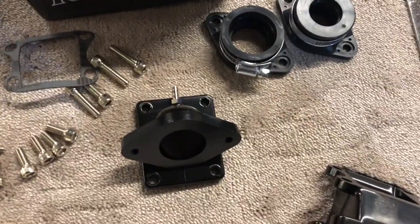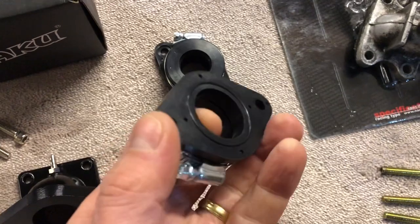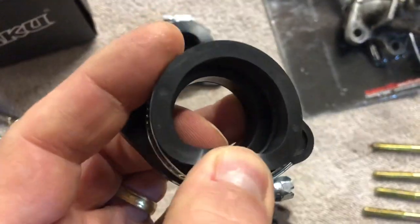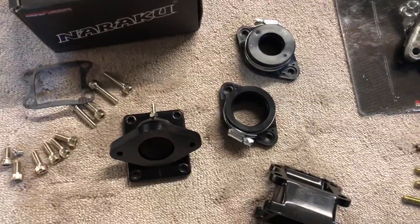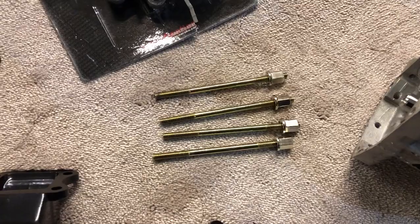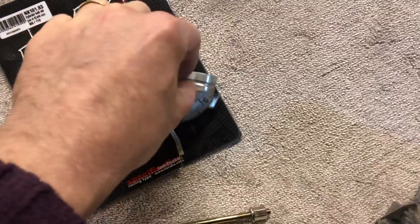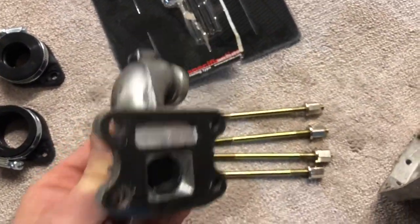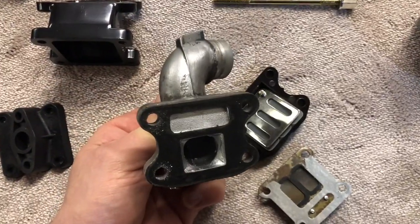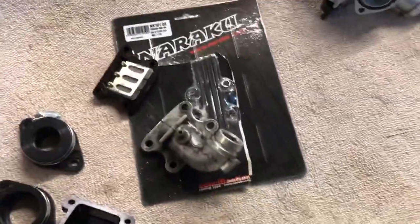It comes with a couple of carb adapters - these are metal impregnated flanges with a rubber socket for the carb to fit into, so I might use one of those. The same company also do some head studs, so I've got some of those as well - about £5 a set. That's the old Speedfighter manifold to fit on the triple block - it's for a Peugeot 50 or 100 Speedfighter - so I'm not going to use that; that can go back on eBay with those reeds.